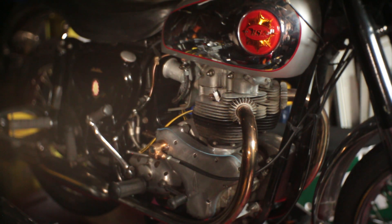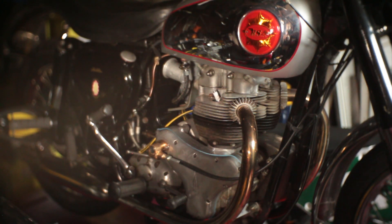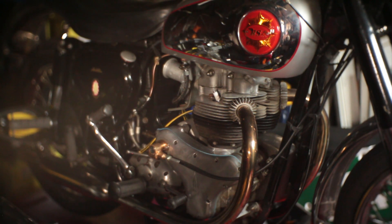And then I started riding it, and it wasn't going very well at all — it got very, very noisy, very clattery. I'm not quite sure what it is. It could be just a simple thing like something in the timing gears, it could be something gone with the camshaft, it could be tappets, it could be a broken spring. But I realised that the engine has not been touched in 40-odd years.